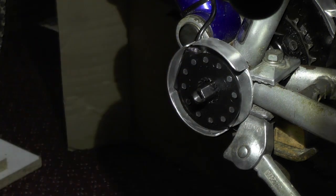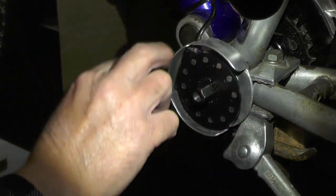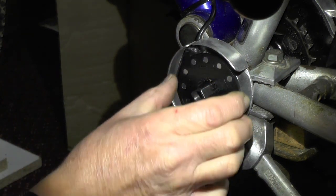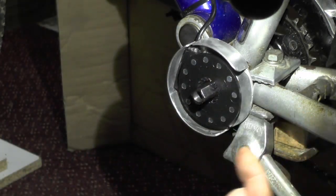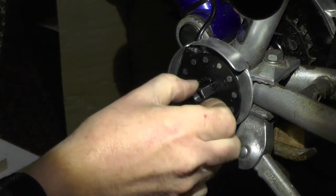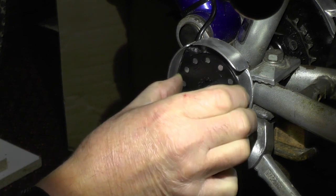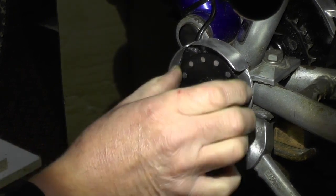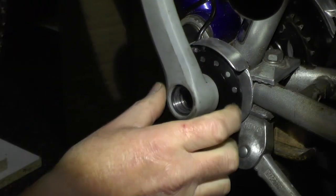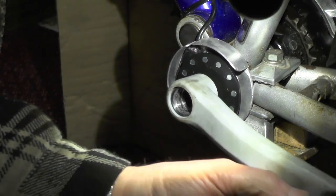So I made this guard — you can see that in another video — and that's stopping the dirt getting in. There are teeth in the centre of this magnet ring, and when you buy it they're all pointing radially into the centre. When you push it on, they fold over to try to grip the square shaft, but after a bit of use those teeth have set and they're not gripping anymore. So when I'm pedalling, every now and again the magnet is wobbling and then picking up, wobbling and picking up, and so on.